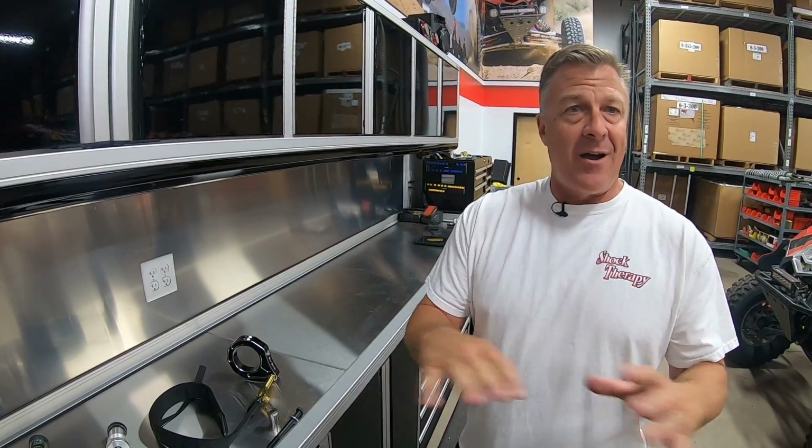So when you buy wheels and tires, you buy aftermarket arms, or you buy a spring kit that might speed up the rebound at the end, you're going to pick up that clunk. Super common, it's common in stock cars too.